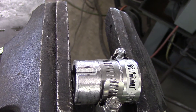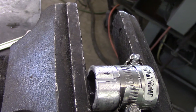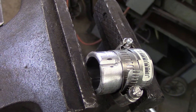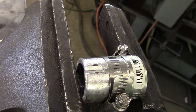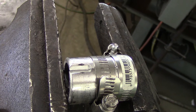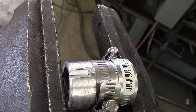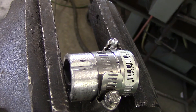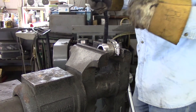As you can see here, I have V'd out both sides so that I can get pretty close to 100% penetration for about a half an inch on the nose. Later on, if they need to repair this transmission and split the two halves, they will have to grind that out in order to be able to split it. But it will give the snout much more rigidity and strength because it will be basically one piece instead of two section halves.